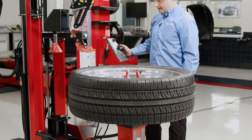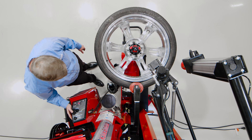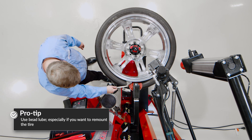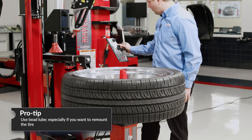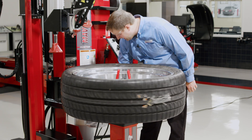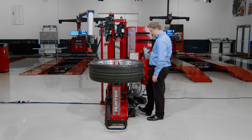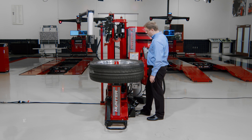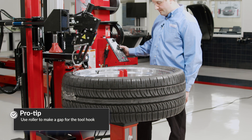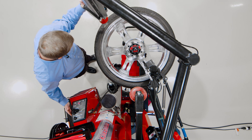The tire changing process itself will employ a lot of really familiar techniques. I'll set my diameter, break my beads, and give a little bit of bead lube. It never really hurts — especially a good idea if you know you're doing a flat repair and have to go back on with this particular tire. Not all tires are discard tires, so this really helps relieve that bead stress and gives it an added level of safety. I'll bring my roller around, then my TPMS around, and if I have to, I can make a little gap for my tool hook to go down into — making sure all the way around the edge of the wheel the tire is falling down into the drop center.